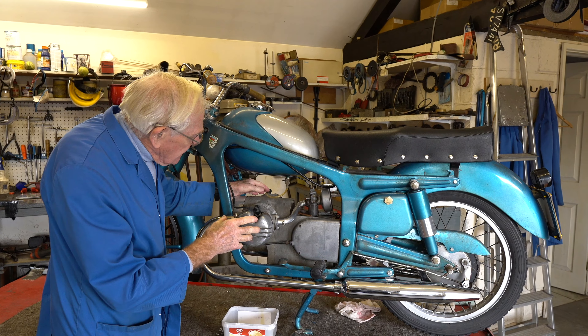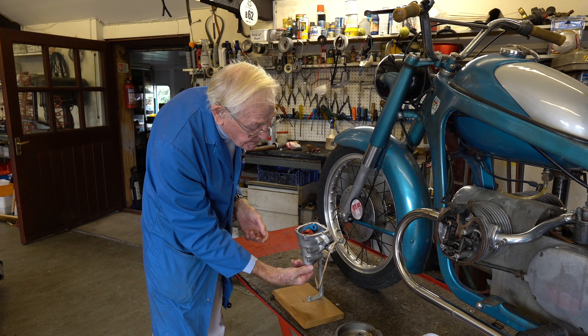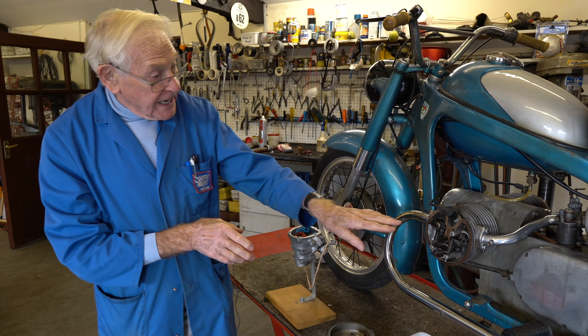So how it works: this is the rocker. This is a twin cam, face cam. There's only the one cam in a single, but this one has got a cam for the exhaust and a cam at the bottom for the inlet. So you can get better timing facilities if you've got two cams — one cam for the inlet, one for the exhaust. Brilliant idea. Don't know why it never caught on better. But those are two examples of face cam — very pleased with it.